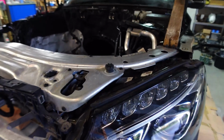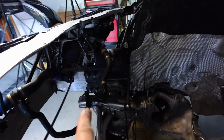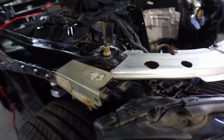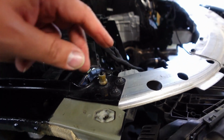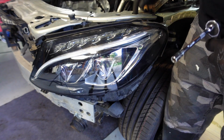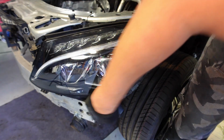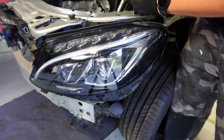After the lamps, I need to undo those 3 bolts on that side, and there's 4 bolts on that side. And finally there's 2 bolts each here, which need to be undone. So let's get cracking. Okay, so to get this lamp off, there's 3 bolts holding it. One here, access from here, and there's one right on the bottom there, which you access from the rear.